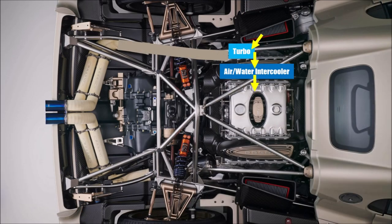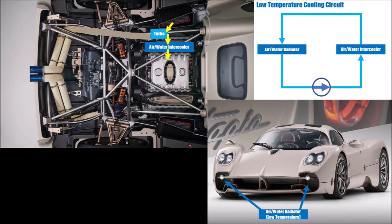After the air went through the turbocharger, it flows through an air-water radiator on top of each bank and then flows into the engine. That's the so-called indirect system — we don't cool the charged air directly with air, which would require large air intakes for the intercoolers. Instead, we cool the charged air with a low temperature water cycle that includes radiators in the front bumper on either side. So altogether, that makes four radiators, but that's something we already know from the previous models.